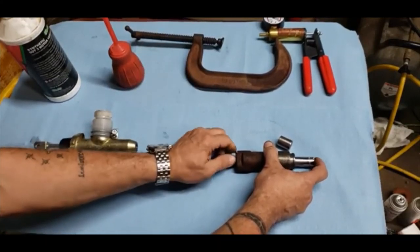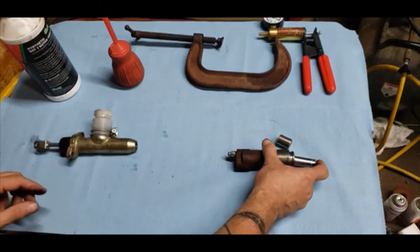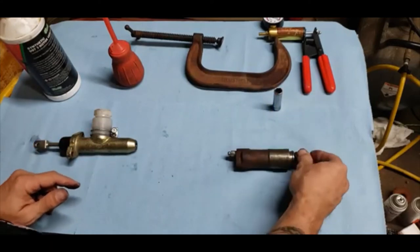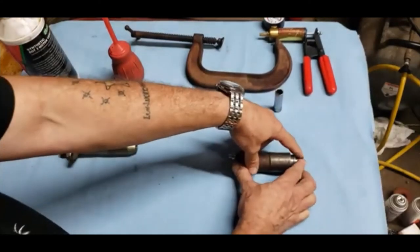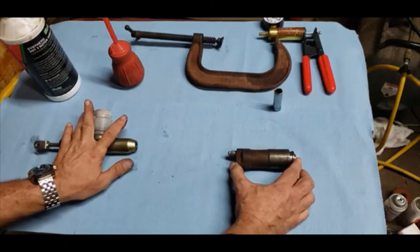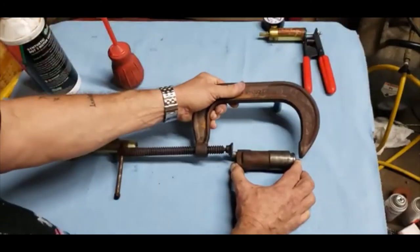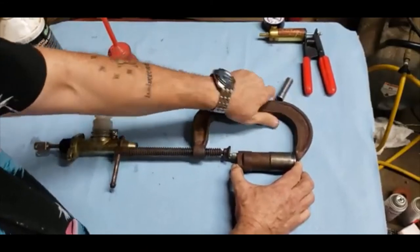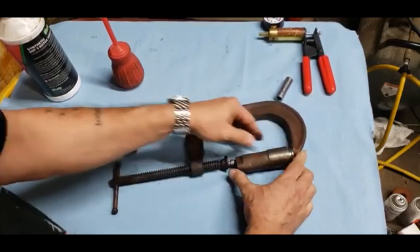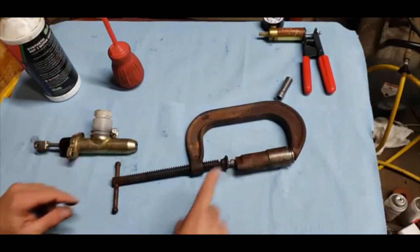On the fourth time, when you open the bleeder you should see nothing but clear fluid come out. Tighten it down and release. Make sure your master cylinder is full. Remove your long socket, take your short socket, place it back in there, and push it in a little bit. Remember — pushing on the piston sends fluid backwards, so have plenty of rags and paper towels up at the master cylinder to collect the overflow. It is going to get a little messy. Then apply the clamp again — it doesn't need to be super tight, just hold that piston from popping out.